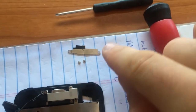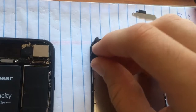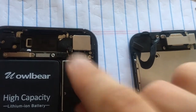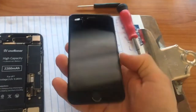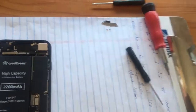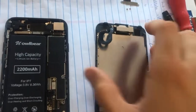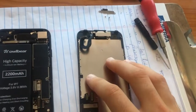After taking out the two little screws and removing the bracket, this cable here got pulled up, and this exposes the little connector right here. Now we have completely detached the old broken screen, so out with the old and in with the new used screen that I have right here. And this one is not cracked, so it's pretty nice.